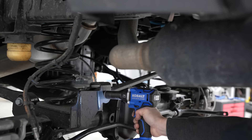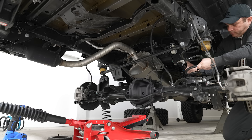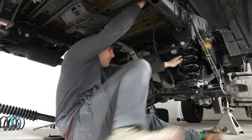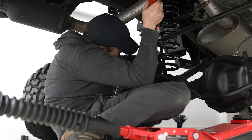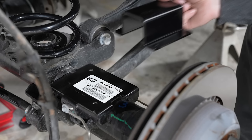It is necessary to remove the rear track bar bolt so you can get the coil springs out. If you want to make your life a little bit easier, go ahead and break loose those big 24-millimeter bolts for the control arms. As you can see here, the reason the axle is not drooping is because there's so much tension on those rear control arm bolts. I ended up just putting in the new springs. I had to use a wedge and kind of push the rear coil to get it set in place on the driver side. I ended up using a slide hammer and setting the tire on it to act as a little bit more weight so I could get the coil spring in — it was a bit of a pain. In hindsight, I probably should have just taken the control arm bolts loose. Got it in there and had to spin the coil around to make sure it was lined up correctly.